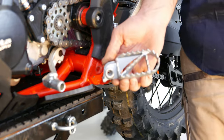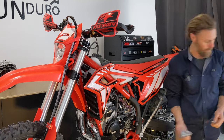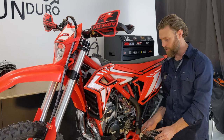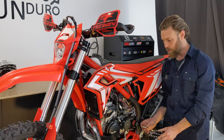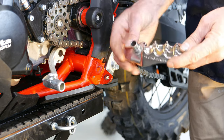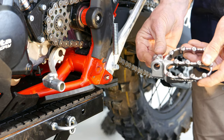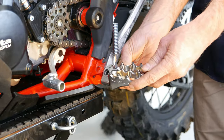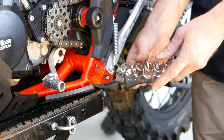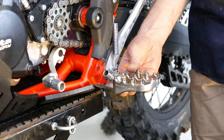As much as I am not a fan of these stock pegs, it's also a really good idea to keep them as backup parts so you don't have to wait to order things if you break something. With these new pegs you have options for height and front-and-rear adjustment. The universal collar system can go in either from the top — which lowers and moves the peg back — or from underneath, which brings them up and forward. We're going to try them down and back to lower our centre of gravity.